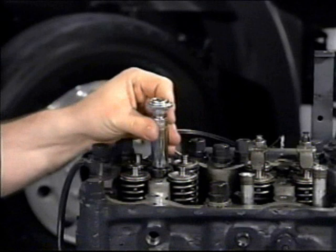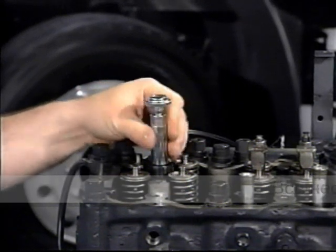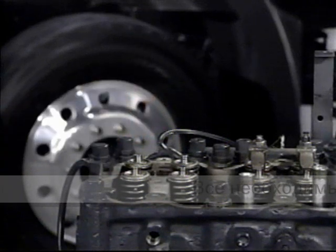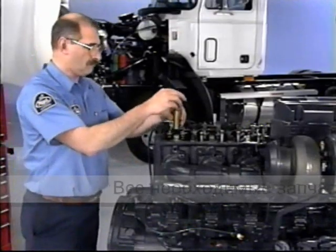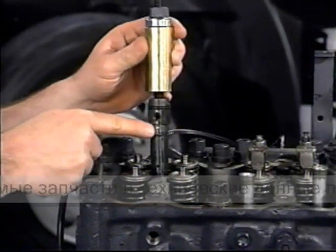Get servicing the nozzle. With the fuel line and valve cover already removed, remove the nozzle retainer on the cylinder head and thread in the special nozzle removing tool. Turning the draw nut on the tool, remove the injector.